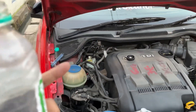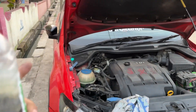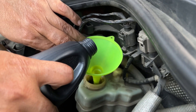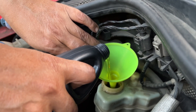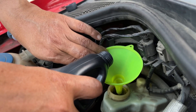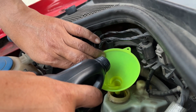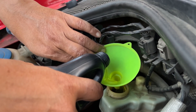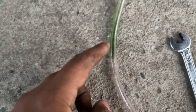We'll be putting that in and opening the wheels and bleeding them right now. Let's see the rear wheels — I think green oil is gonna come. See the quality — it should be pure yellow/golden color, but it was totally black. Almost 250ml will go out, and after bleeding whenever it gets low we need to just top it up with the new oil. I've already taken out the jack. See the oil is going — it's pure green coming out.